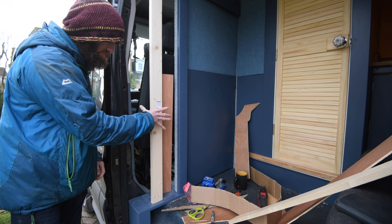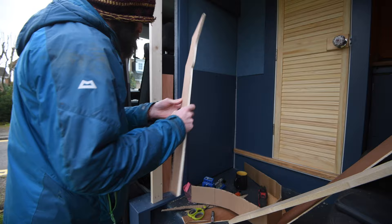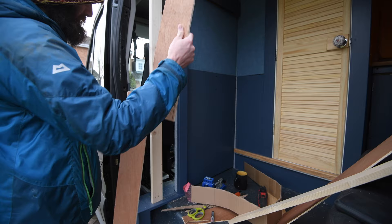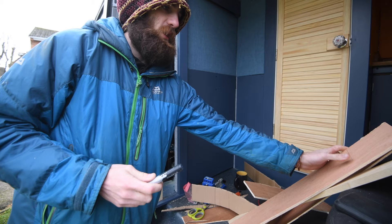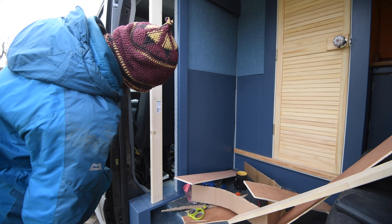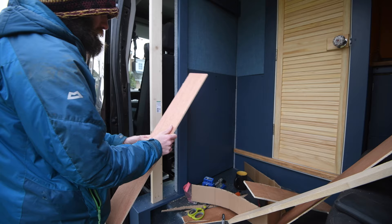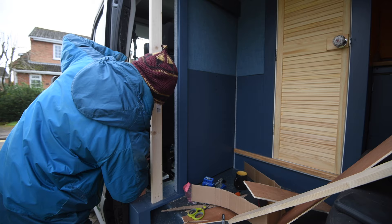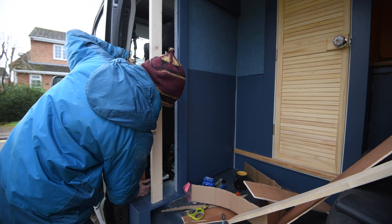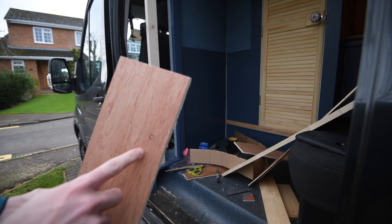I've been working on this little finishing bit. It's all pretty easy to do apart from the actual bulkhead side because that's a really weird contouring shape. I've made the pillar generally - using my scraps to finish it off. To figure out where the bolt holes are, as you've seen on previous videos, I'm just going to use a dry marker colouring the bolt heads, because I put all the bolts in the old bolt holes. Colouring the bolt heads with pen and putting my piece in the right spot will hopefully imprint all the ink onto the right positions, so I can drill out the bolt holes in the right spot.